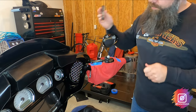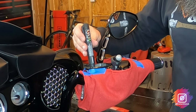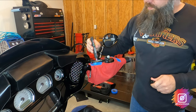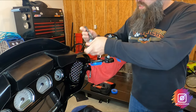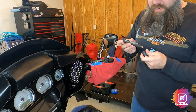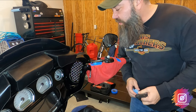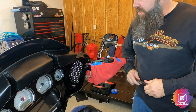I'm going to go ahead and test and see how much moisture I have in my brake fluid. I have a nice little tool here — just turn that on. And I have too much moisture, greater than 4%. I'll leave a link in the description with this tool. You can just change it every year, two years, however you want to do it. You can tell the difference — it's got a brownish look to it versus clear when I put it in.